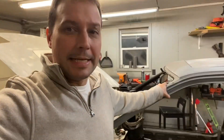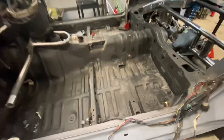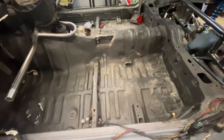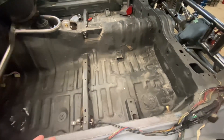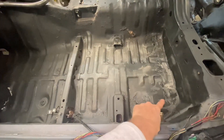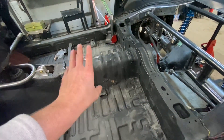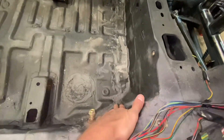So today we're going through and seeing where the mount points are, and I'll just kind of go through this with you guys as to what I'm thinking and how this is going to play out. To make this cage work and for it to be a 750 capable car to certify, we have to mount plates here and mount a plate over there. I'm just kind of playing around, mocking up stuff, and bending some steel to see how well a plate mounts in this corner.